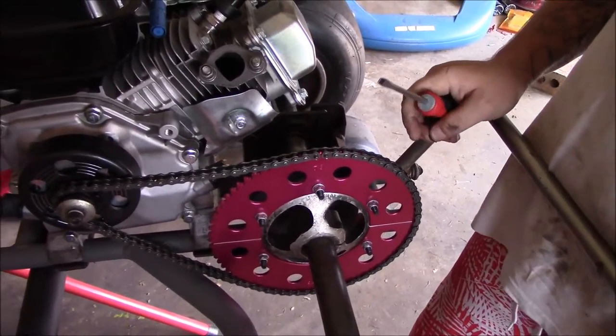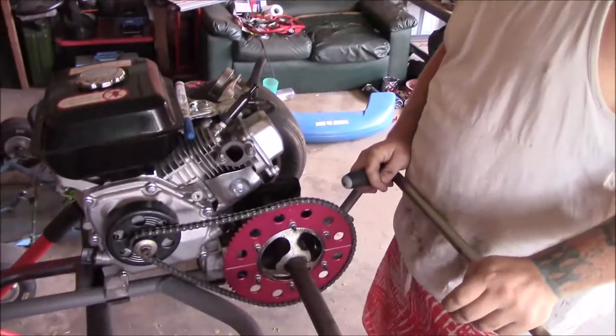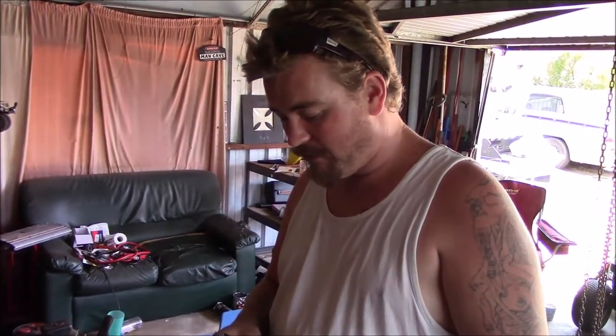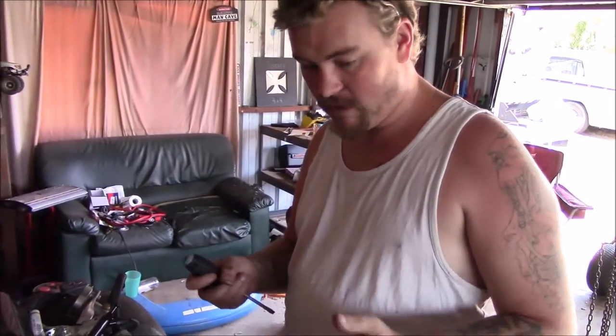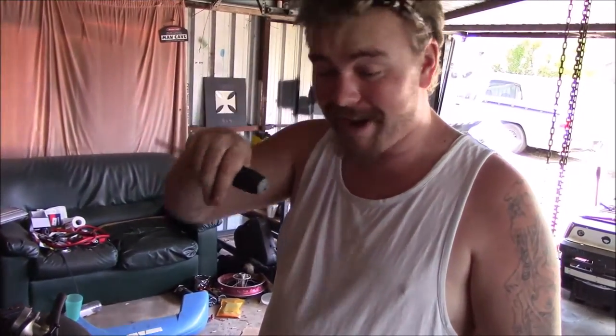The chain is cut and shortened. After grinding down the pins, I get a screwdriver in behind the link, give it a tap, and knock the outer link off — then it's self-explanatory from there. When removing master clips, go to the outer side of the clip, rest your index finger over the closed side, and push from the open side so when the clip pops off it doesn't fling across the floor and get lost.